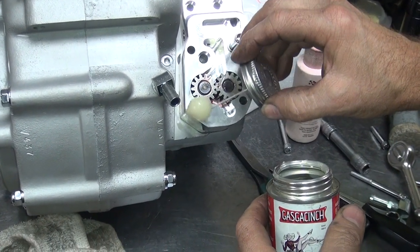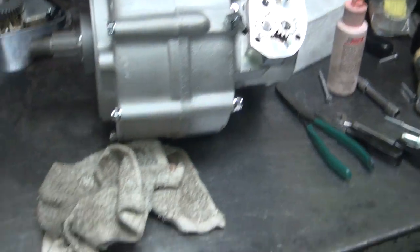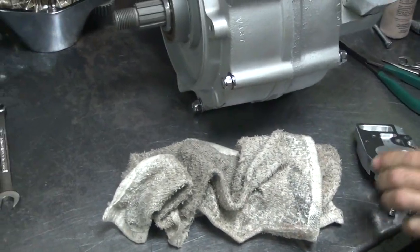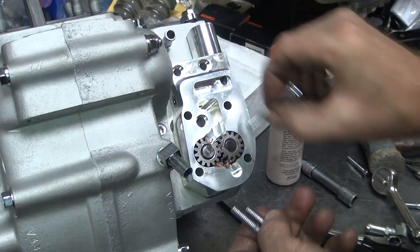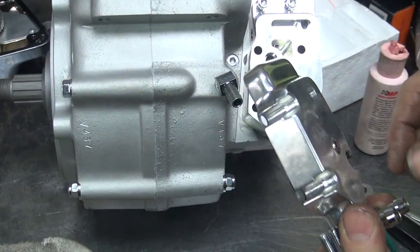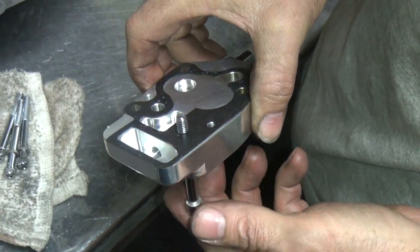You can also hit it right on the edge of these holes here, but it's kind of dangerous. Remember how that gasket is real thin right there? But we don't want to put the sealant inside the gear cavity. We've already got the gasket previously stuck on there — hopefully it's stuck in the right spot. Take this out. And if you had a Harley pump, you'd have to put these two top ones in and tighten them up already. Being a smooth top pump, that ain't an issue. Now if you just go shoving these bolts through, you can catch on the edge of the gasket and shove the gasket right out of it, so you've got to be careful.